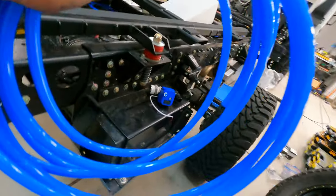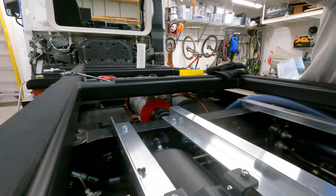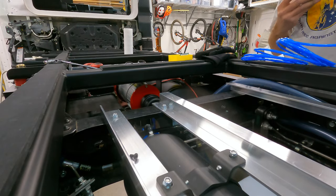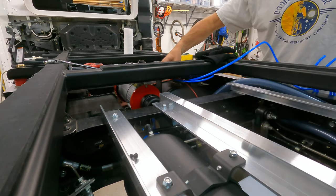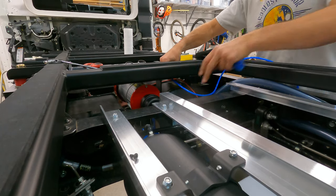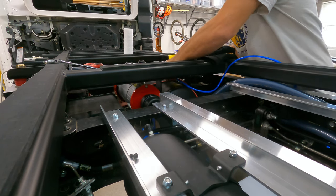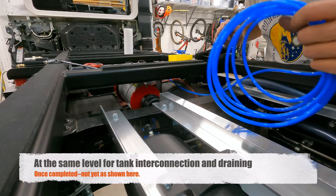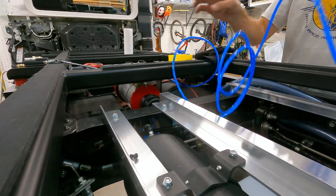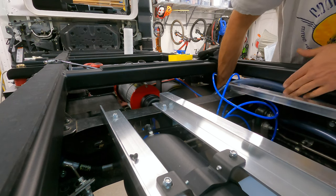I'm routing these connections up to each corner — I'll show more in a future video of the ports I'll provide at each corner. Also worth pointing out is a stainless steel electronic valve sitting on the fuel tank; that's my electronic valve to empty the gray water tanks, which can be done by switch from anywhere appropriate. That's a one-inch line, and you can see the one-inch antimicrobial gray water line running down the passenger-side frame rails at the same elevation between the three gray water tanks, so water flows between all three tanks and out to that drain just above the axle.